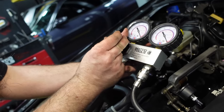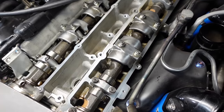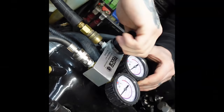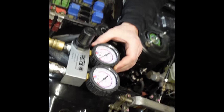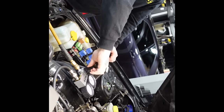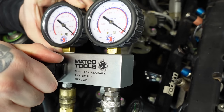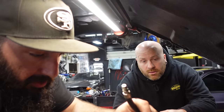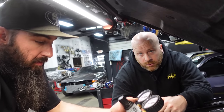That scared the f**k out of me — did it turn over? Yeah, I knew it would. That one's at 92 — so that's cylinder three, only 8% loss. That's not as bad as what I was told. Cylinder six is looking good at about 95. When we purchased the car, they told me cylinder three had 22 PSI out of 100 and cylinder four had about 40 PSI out of 100 when cold. Once the car got to operating temperature, you got the numbers we're seeing now. The car smokes like crazy out the back — so this is a very mild head gasket. The engine's fine.